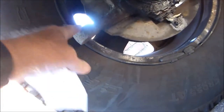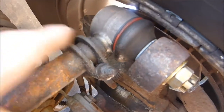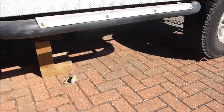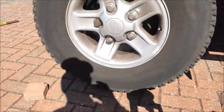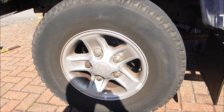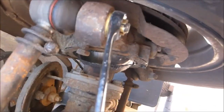Fixed at one end — left hand drive of course it's fixed. It's obviously Land Rover — you've got one there for left hand drive. But this is a right hand thread on this so I've got to screw it. Back wheels chocked, jacked up, wheels clear of the ground — now ready to take off the nuts at the end. That's the clamp, slackened off with 11mm, and the bottom of the swivel 19mm.